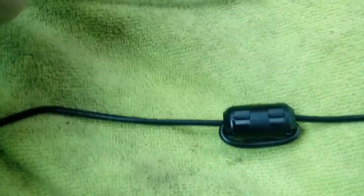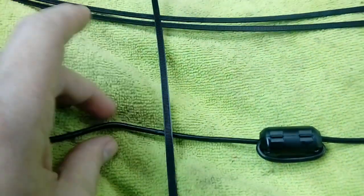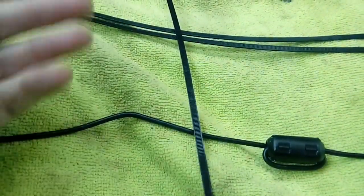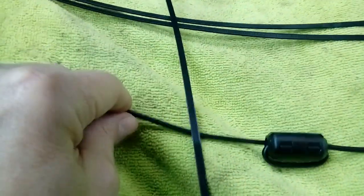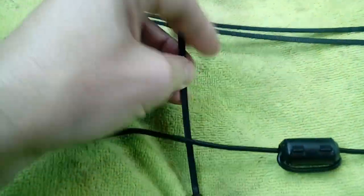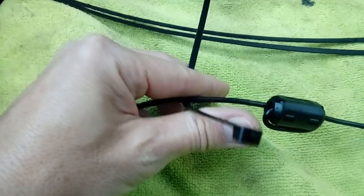So, cable ties. What I use these for is to beef the cable up. Now obviously this is going to be tucked on your headlining above your window screen. If you hit one of the big potholes, there's a possibility your cable will basically fall down in front of you. Well, in front of your passenger's view whilst driving along. Not ideal. So all we do, we use this to beef up the cable, make it thicker, so that it's got something to hold on to behind the headlining.